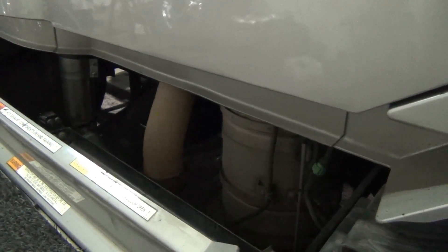We also got our exhaust dealt with. There's the DPF, and of course the exhaust comes off, runs up along the frame, across a couple of elbows. You can see that it's all wrapped there where it might reflect up or heat the bottom side of the sleeper. We fabricated and welded a new bracket right down here that goes all the way across and bolts to the frame — it's very well supported, and of course that points out and away from the truck. Exhaust is done.